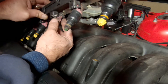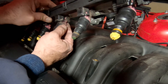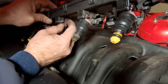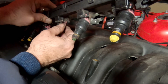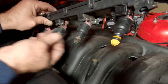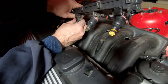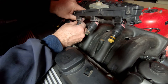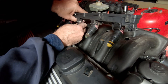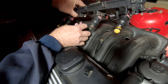There's one clip on the injector here — it's a little clip that rotates around and clamps onto the injector, and there's a hole where it clamps onto the fuel rail. You just pull that clip off just like that. Once that's done, pull it out of the harness because you just undid the clip and it'll just pop out all at once, just like that.